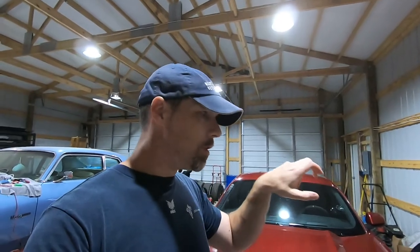Let me explain. On the way to Ford Takeover, and actually on the way back from Ford Takeover, I was a little nervous towing the car that far because of one particular reason — I didn't like the way that I had to tie the car down to the trailer. I was able to tie it down and the car was secure, but I didn't like the way I had to do it. The hooks on the end of the strap that would actually hook to the car — I had to have the hook upside down. Normally I like to have the hook this way so that if the strap loosened up, it's still hooked on. I used four different holes in the chassis that were in some pretty good spots and reinforced, but the hooks were upside down, and I just didn't really like that.